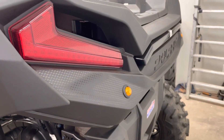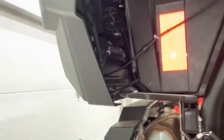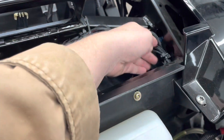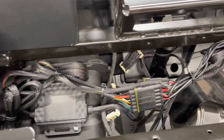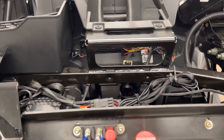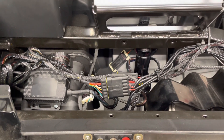On the driver's side, we routed the wire right up along this frame rail behind it the best we could, then came down and put a hole in the plastic right there for the turn signal. On the passenger side, you can see where we came out of the tunnel — we zip tied it here, came up that frame rail, right across there, and down. Same thing, mounted it in this location. Afterward, we took our time and went around and zip tied everything up neatly so that nothing's going to be shaking or rattling. We're very happy with the way the wiring turned out and the way that the Rough Country kit is set up — it was intuitive and quite easy to install.